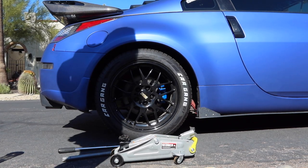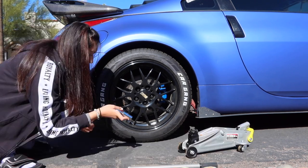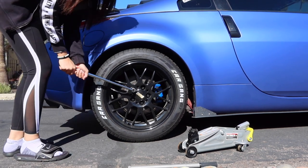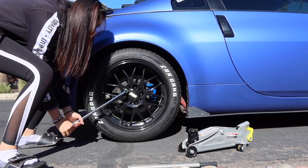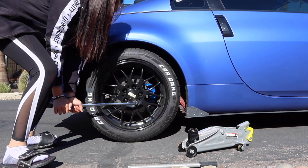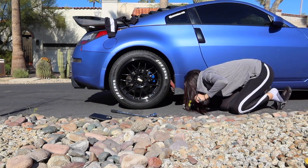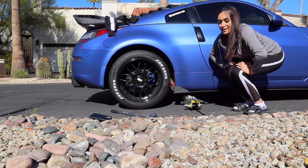I'm going to set you guys right there. First things first, grab some coffee. We're going to loosen up the lug nuts just a tad bit before we actually jack up the car. Do you guys see how my car is already rolling back? That is not good. Star pattern, don't forget. Now we will be jacking up the car. My side splitters are kind of in the way, but I think they'll do.